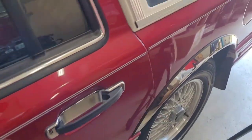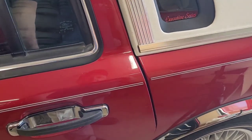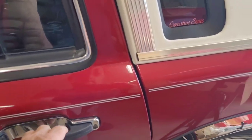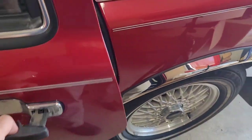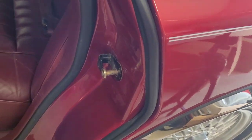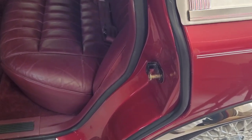Now, hear this? Click. Door doesn't want to shut. Click. Door doesn't want to shut. You got to slam it. It'll shut. It's because the bushing's gone off the door striker bolt. Really simple fix. I can't stand it when you see somebody trying to sell a car and you hear that